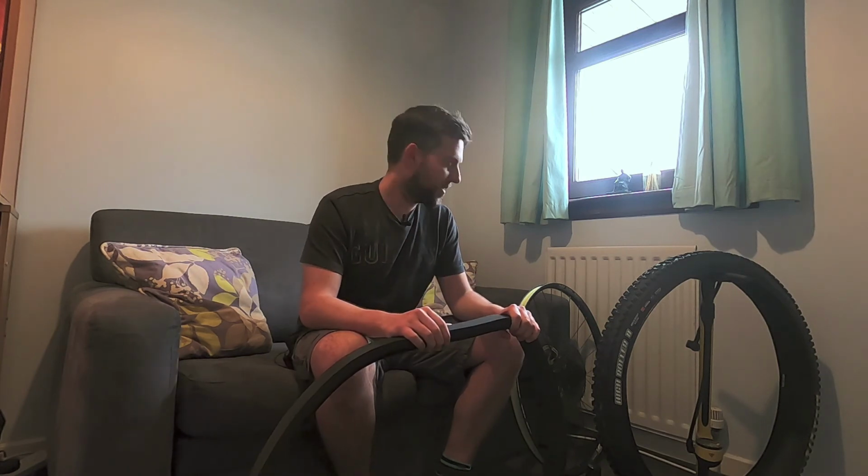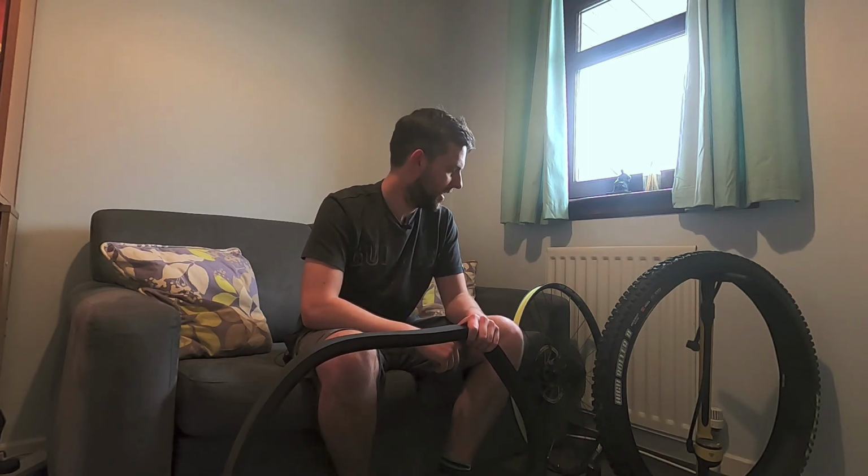Now in my previous video you'll notice that I went ahead and pretty much buckled my rear wheel to within an inch of its life. I did actually get it straightened, got it trued, and I went on a couple of rides on it. It was okay, it held air, but it was coming straight out of true again, and on the side where I dinged it, to get it true, all of the spokes on one side were up super tight, and the ones on the other side were pretty much slack, so it wasn't really a long-term solution. I don't think it's going to last.